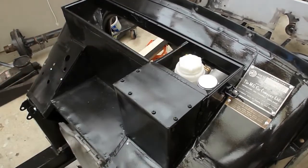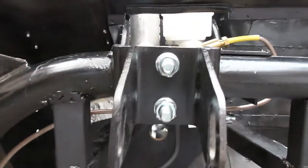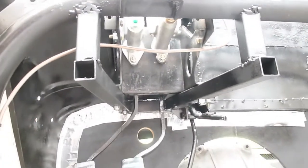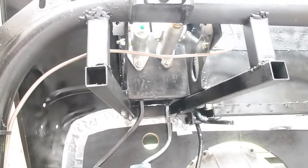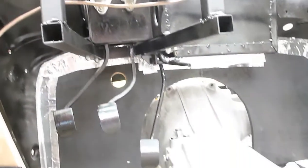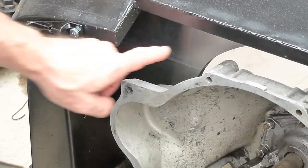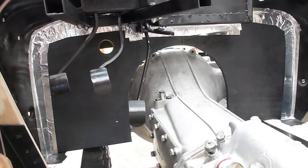What I did was add this box to the front of the toolbox so I could mount my hydraulics in here. This is the view from inside the cockpit — there's the steering mount, and you can see I made a cradle or bracket to mount my hydraulic cylinders to. I also made a plywood firewall which has aluminum on the front, sealed with heating and cooling duct tape.